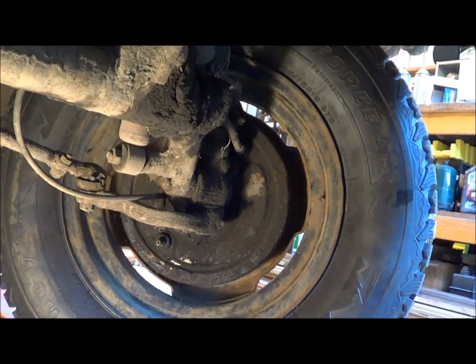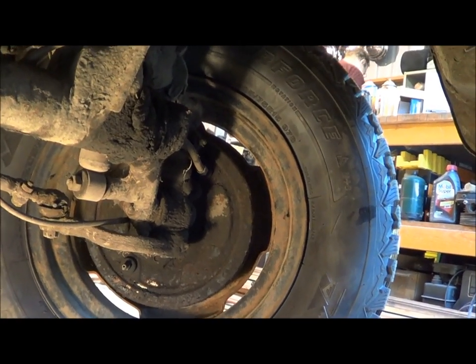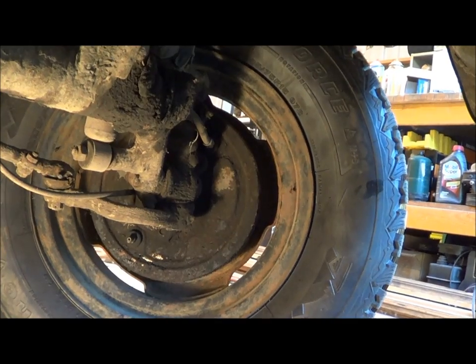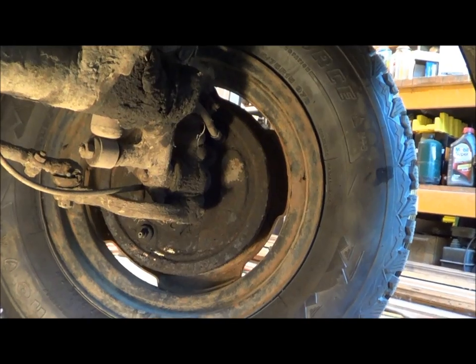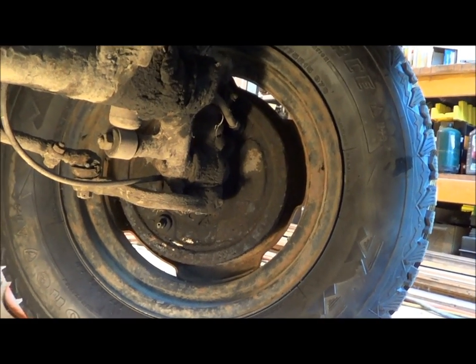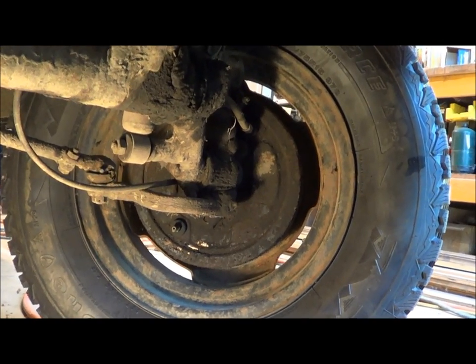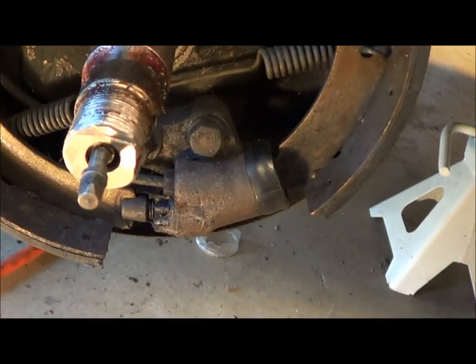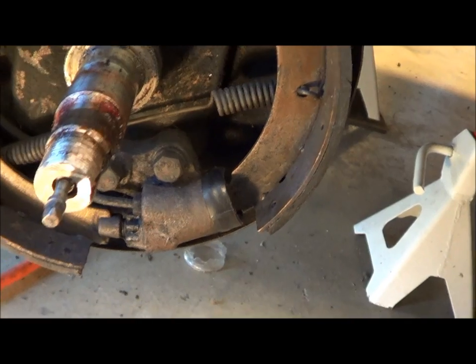Next I've got to pull the wheels off and grease or repack — whatever I've got to do there. Check those wheel cylinders — there are two on each side on this, two half cylinders. They're not cheap, so I'm hoping they're not leaking, although I do have two brand new sets, enough to do four front wheels on buses. I got this driver's side apart, and the little speedo cable is sticking out there. I think the speedo cable's no good, which is probably where my click is.